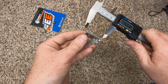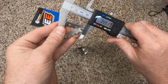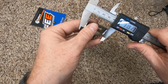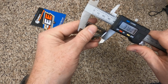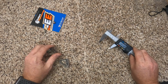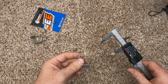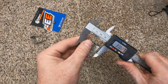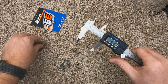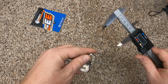So we'll call the front to back the width. We're going to be sitting at 34.9 millimeters versus 37.8. So quite a big jump. We're 3 millimeters longer. Now this one, 34.6 is how far that pedal is going to stick out, whereas that one is 48. So that's quite a gain.